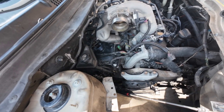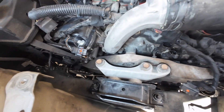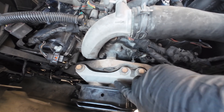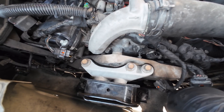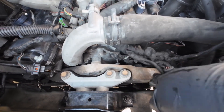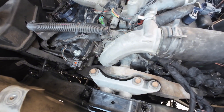As it turns out, the bank two sensors are gonna be the pain in the ass to get to. The camshaft sensor bolt — a 10mm — won't let you pull it all the way out because of this big brace here. I can't get this brace off until I remove the engine mount. These three bolts off, support the engine while I do it, then take off those bolts right there — otherwise I won't be able to change out either the intake one or the exhaust one.